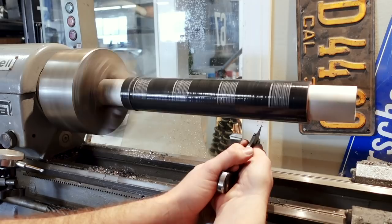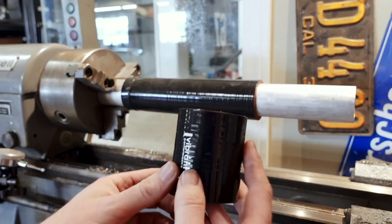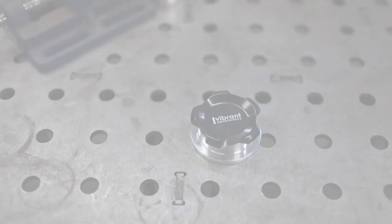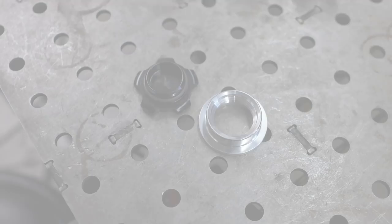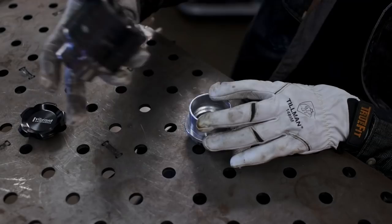We need a coupler in order to attach this to the fuel cell, so I'm showing you my favorite trick for cutting really nice coupler edges. By no means am I suggesting this is safe or the right way to do it, but if you have a lathe I haven't found a better way yet — it's the only way I've found to cut couplers without having weird frayed edges or uneven corners, and it gives you a part that looks like it came off the shelf. Finally we need a gas cap, so I'm using this Vibrant billet cap and threaded bung, which should be a nice simple solution.